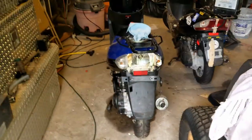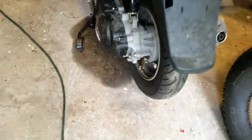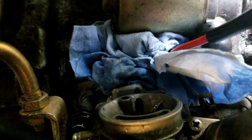Back at the shop working on the scooter. I just got home from work and my old man told me the scooter was leaking — there's gas on the floor and it really stinks in here. Got the door open though, so we have good ventilation. You can kind of see it dripping, so I'm pretty sure my float is stuck open, which means I have to take it off.